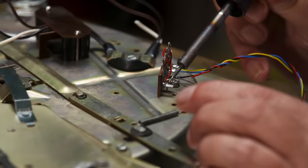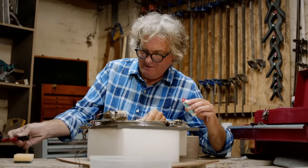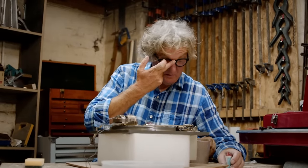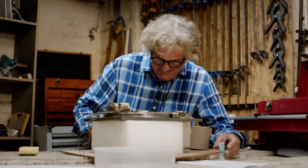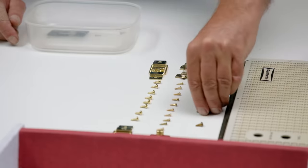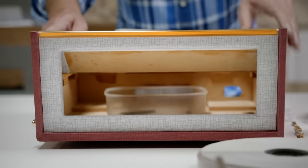I've got a bit of solder on the bit — there you go. That's not bad, but it's not the purest way of doing it. The purest way is to hold the iron and the wire onto the tag and then apply a blob of solder so that it flows around it nicely. But the problem with that is that you need three arms — and that's something you'll hear people saying about soldering all the time. Beautiful. That deserves a swig of tea. Two self-tappers, and we need the grill itself, the baffle plate, backing plate thingy, and the cabinet of the beast.